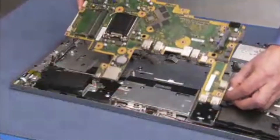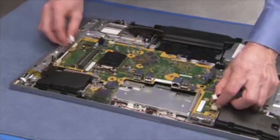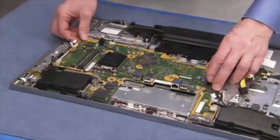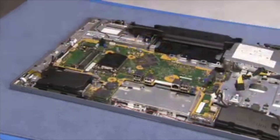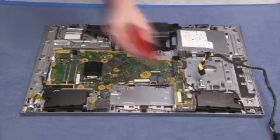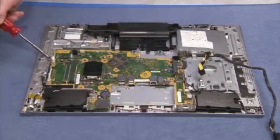To replace the motherboard, carefully align the USB ports under the tab and place the motherboard down onto its standoffs, clearing any connectors away from the sides of the board. Replace the 9 Torx 15 screws to secure the motherboard to the base pan in the order indicated by the stencils on the motherboard.